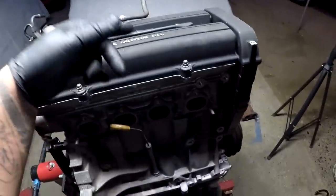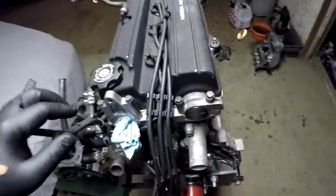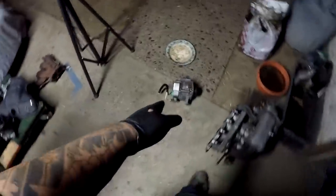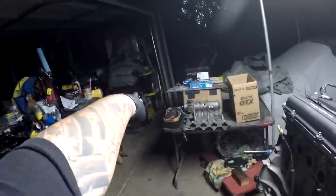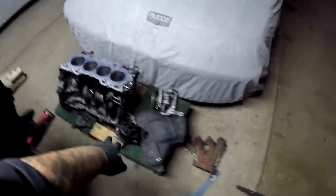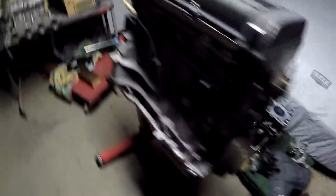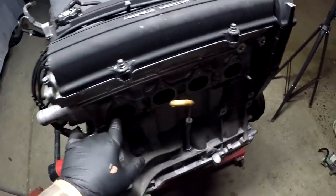All right guys, removed the head bolts. I just stripped everything off the cylinder head and block to make the process a lot easier, quicker, and more efficient without all the stuff in the way. I'm not using that manifold or that alternator — my CGS tuck harness in the CRX is for OBD0/OBD1 and this is OBD2. Header, heat shield, distributor, power steering pump and bracket all came off. Now I'm going to remove the valve cover and take off the timing cover to remove the cylinder head off the block.